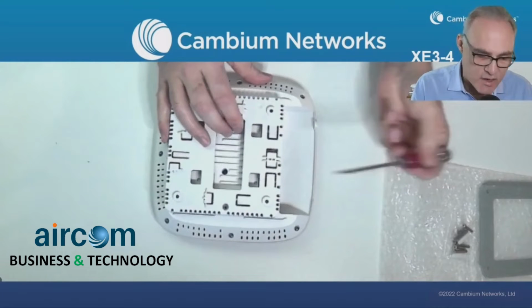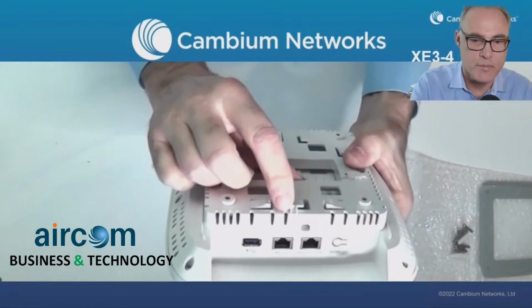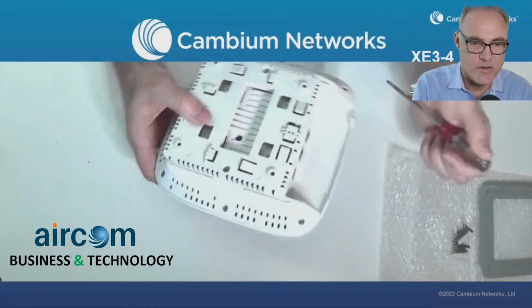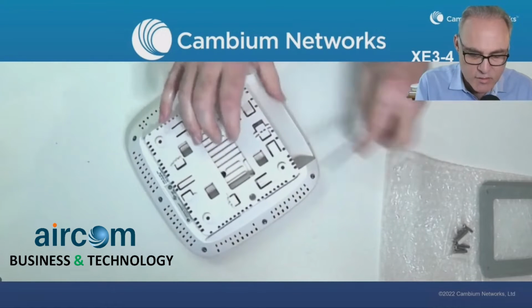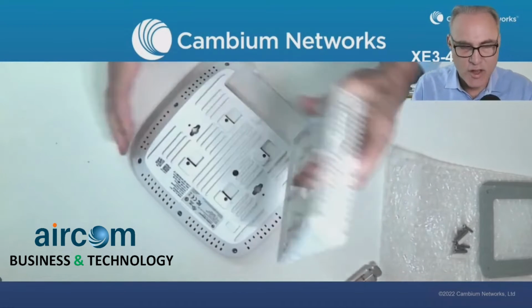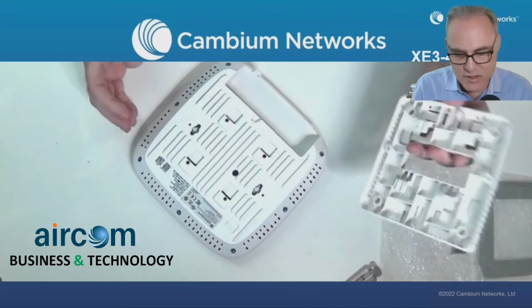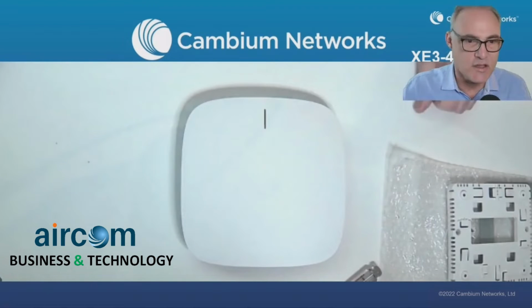So just take any standard, nice small blade screwdriver into this slot right here. If you can see that slot right there, I'm going to go ahead and put it right there in that slot. And I'm just going to put a little bit of pressure to the side, and that's going to release the latch, and the bracket comes off nice and clean. Easy to install, easy to take off, great little designed bracket for this XE3-4 Wi-Fi 6E access point.